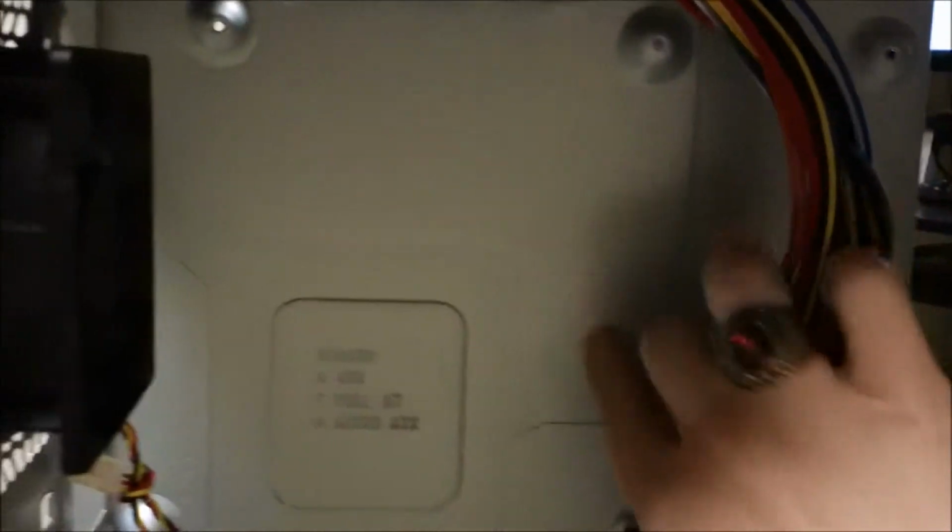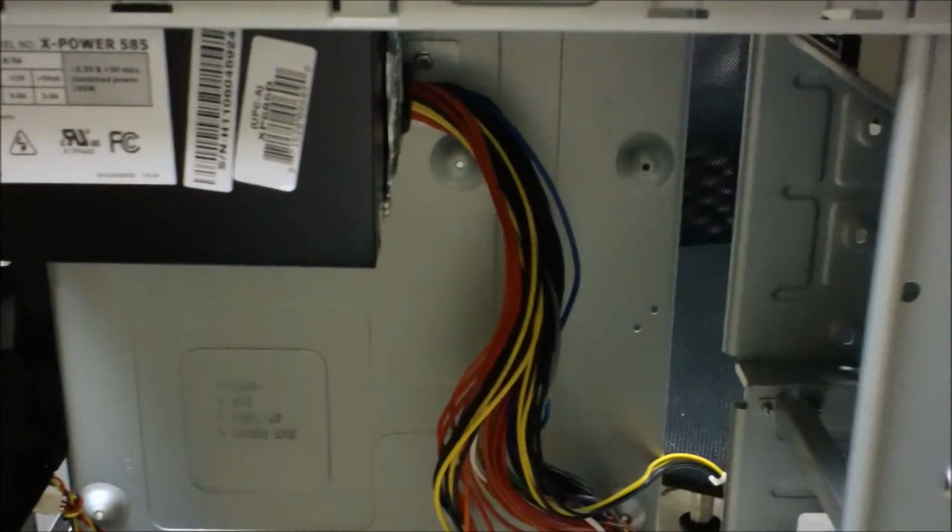Back around on the front side here, you can look back in the back, and if you wanted to do an aftermarket CPU cooler, please be careful. They included nubs for your motherboard standoffs, and there is no room here for a large backplate on those CPU coolers, so please be careful of that. Other than that, that was a look at the HEC 6C series mid-size ATX case.